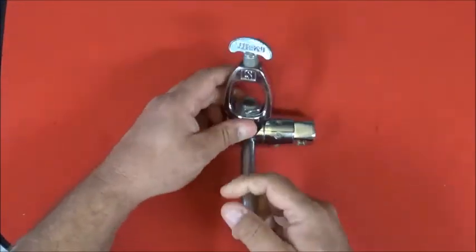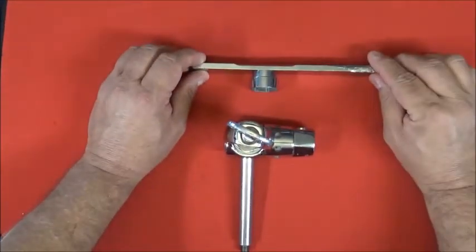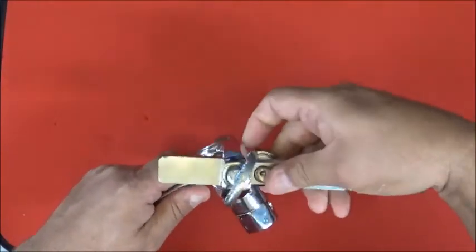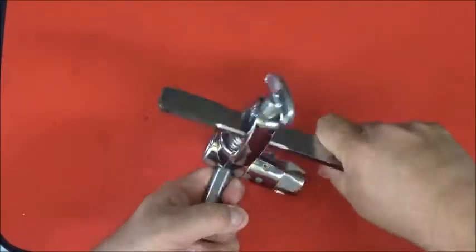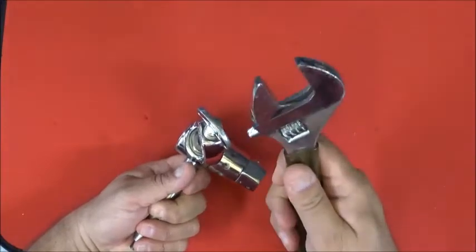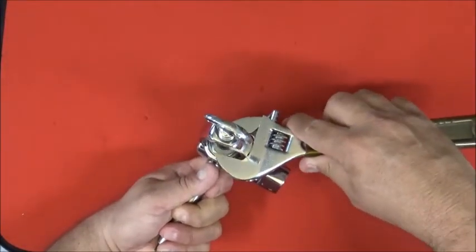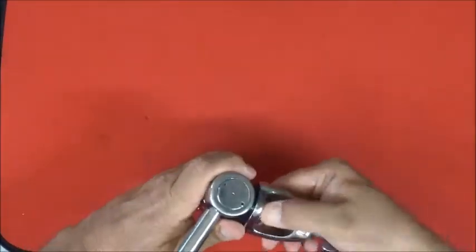You're going to loosen the yoke nut itself. The ideal tool is a thin 1-inch socket with a breaker bar, which holds it just as it should be while it's in the vise. You can screw the thumb screw down on top of it — it holds it very securely and it's very easy to turn. Barring that, you can use an adjustable tool, but be sure that it is close-fitting and that you have it in the proper direction when you're removing it.